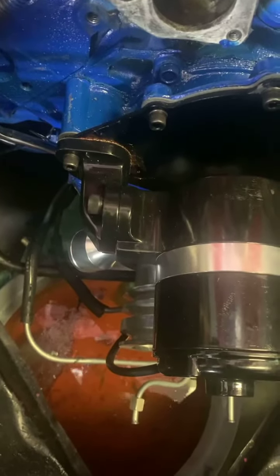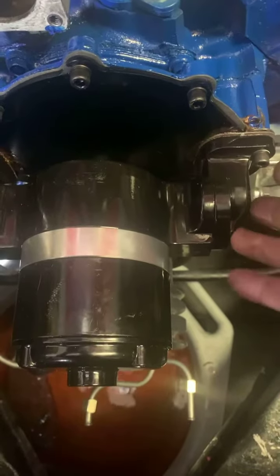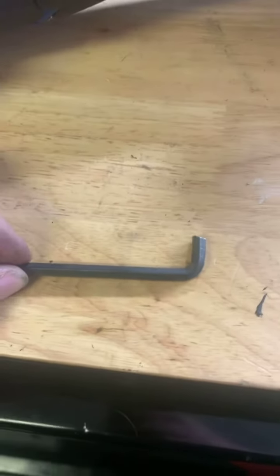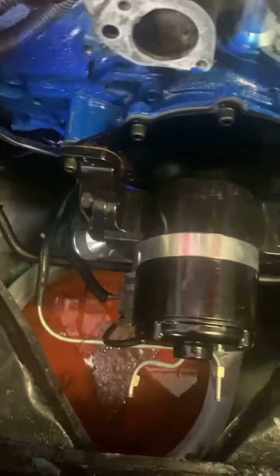The water pump is installed. I had to take those two bolts back out again to get the socket on the bottom bolts, but the bottom bolts are still blocked by these side pieces right here — it was a real pain. So if anybody knows who designed this thing, please slap them for me. What I ended up having to do was take a regular Allen wrench and shave off about half an inch off the end just so it would fit on the bolt between that part that's blocking it. Once I got that cut off, it went pretty smooth. It just shouldn't have to go that far to get something bolted on — that's what I'd consider a design flaw.